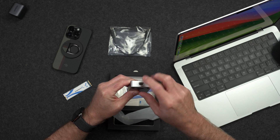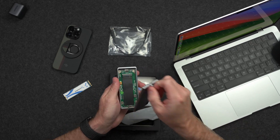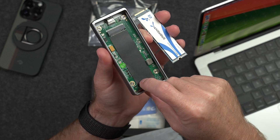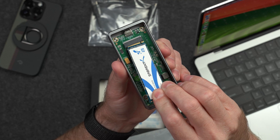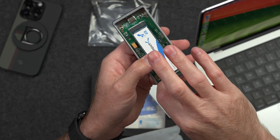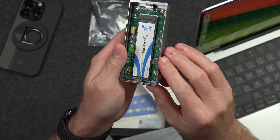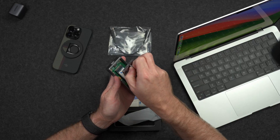It's got a little bit of heft — not heavy, but definitely feels solid because of the aluminum case. There's a Thunderbolt connection on one side and on the bottom a little thumb screw to turn and open up, which is where we insert the NVMe SSD. There's a little retaining ring to hold the drive in place. We line up the keys at a 45-degree angle, insert the drive, push it down, and then move the ring to keep it in place.